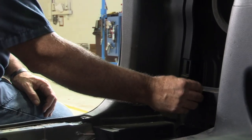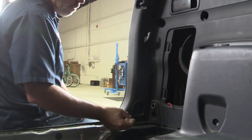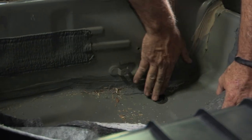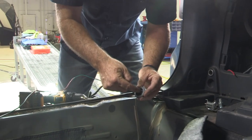Next thing to do is run our power wire from inside the vehicle to outside the vehicle — we're looking for a flood plug. We've got two fasteners holding this carpet here, so I'll take our trim tool and just pull apart on them. It'll come right out of the body just like that. There's a little flood plug here that we can pull out. That goes right down to the bottom of the vehicle, to the ground. I'll drill a little quarter-inch hole through the flood plug and push my wire through it.